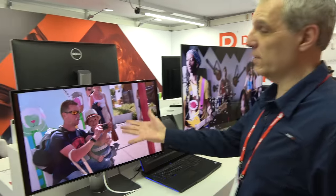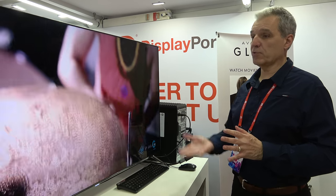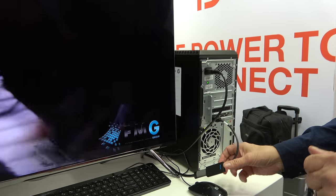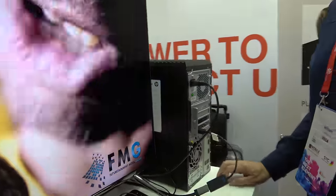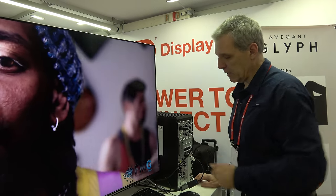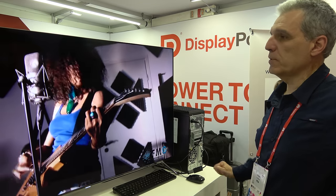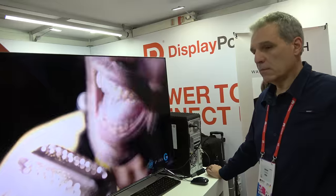This is the same issue everybody has — everybody is taking pictures higher than 8 megapixels and you can never see the quality. You're never going to print it out and you don't have more than a 4K display. And this is a 4K HDR demo — using an AMD graphics card with DisplayPort to an HDMI active adapter, because the TV is HDMI. We're seeing full 10-bit color here. So with DisplayPort you can get to full HDR using DisplayPort to HDMI adapters, and see the content on your television or whatever display you have.